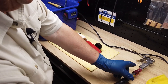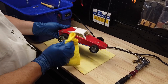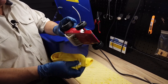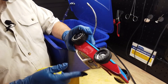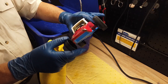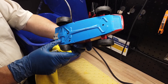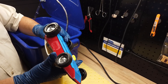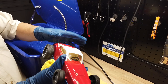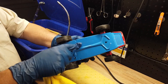Air drying gets all the nooks and crannies, then give it a toweling off. The top is now completely clean — looks nice. The glass was dirty on both the inside and outside. It's still got some water in there, but that'll take care of itself once we start disassembly. It's really nice and clean to work with. It gives you a good start and a sense of how much has to be done on this vehicle. The gooey stuff from the sticker is still there, but I can take that off with some acetone. We're going to paint strip these pieces, then sandblast them to get any rust, because this particular vehicle always has interior rust on the bottom.